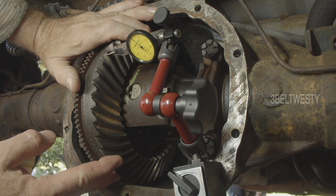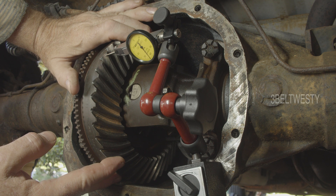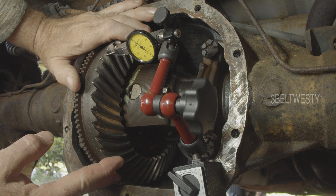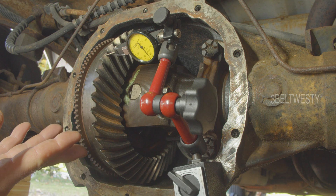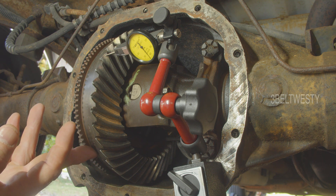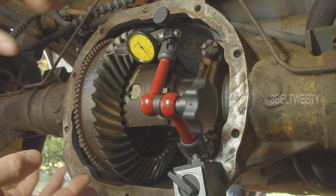The indicator is in metric. Going back and forth on the pinion, we've got 0.44 millimeters of total backlash, and the maximum should be 0.38 millimeters. That's with a ring gear that has about 120,000 miles on this car, and this vehicle went underwater during Hurricane Katrina.